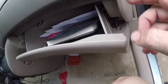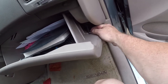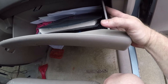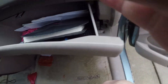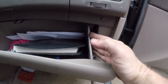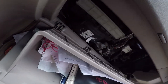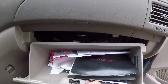The first thing you have to do is get the glove box loose and taken out. There's a little pin with an actuator that slows the glove box as it opens, and a little peg on the right-hand side that you need to pop out. Push gently on the outside of the glove box, and there's another one on the left side — same thing. Pull it in a little bit and the entire glove box should lift out of those brackets.